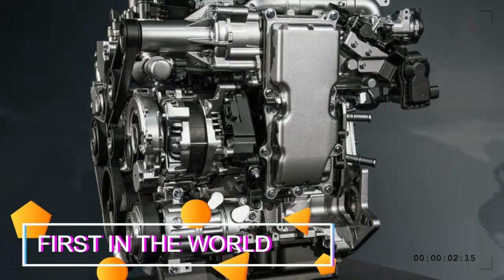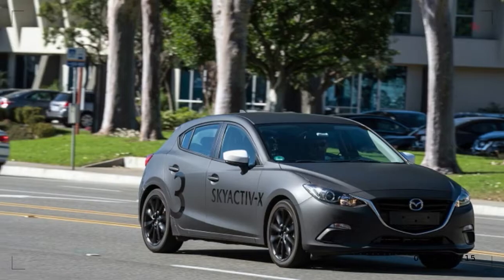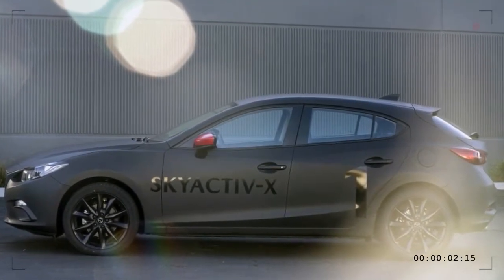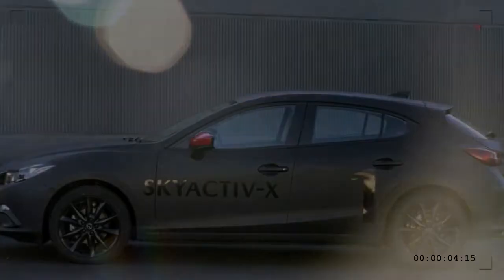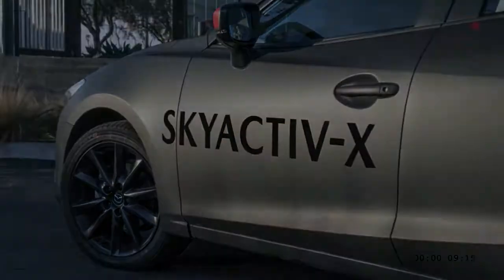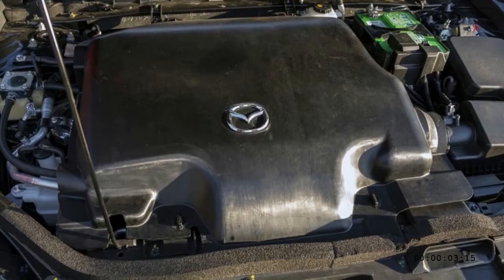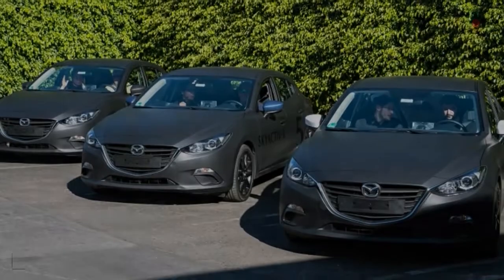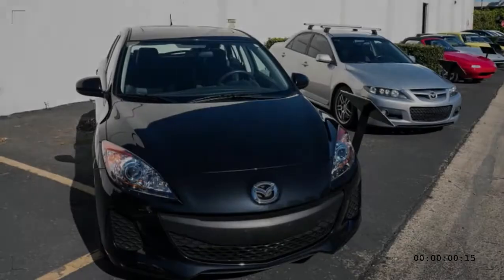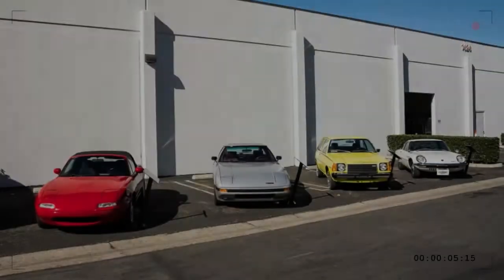That will be essential from an NVH — noise, vibration, and harshness — standpoint, because the clatter is loud and jarring and could certainly hinder broad acceptance. It's coming through despite a significant amount of sound dampening. Mazda refers to this as encapsulation, from a secondary hood liner packed with sound-absorbing material hiding the engine from view, to panels covering the oil pan and undercarriage. Essentially, the Skyactiv-X makes unpleasant sounds even while working well, and Mazda needs to add material to mask them — the price of innovation, it seems.